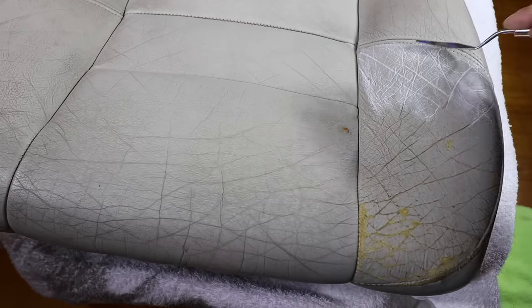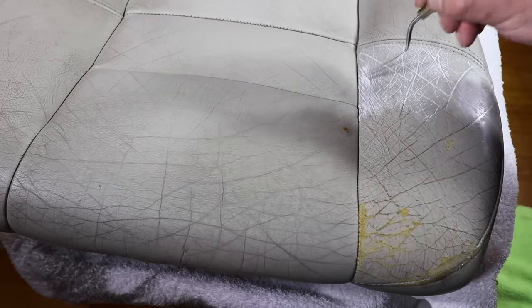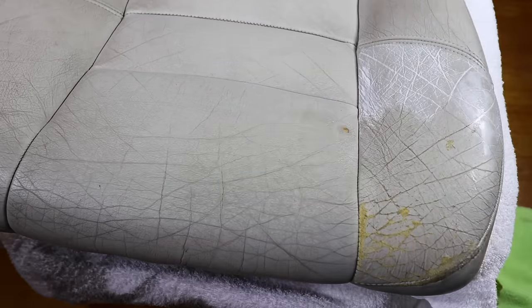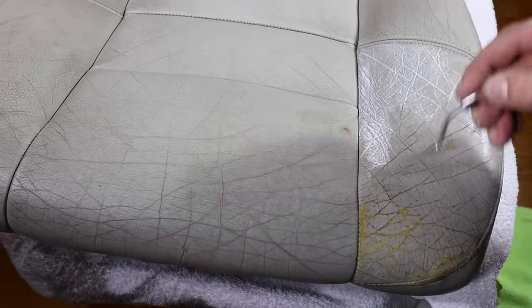The most important thing to focus on in this step is to apply the bare minimum of leather filler that's required, and that you ensure the application is as level as possible and that it does blend seamlessly to the surface. I'm just going to apply a small amount of the leather filler at a time, and mainly using the small spatula, but also my fingers in some of the tighter areas, to ensure I have a uniform and smooth level finish.